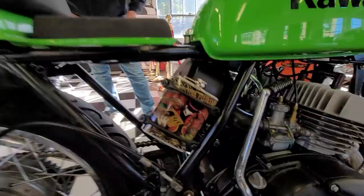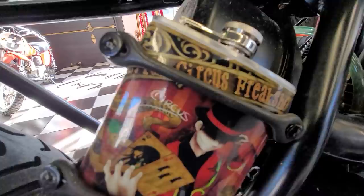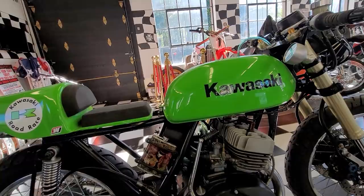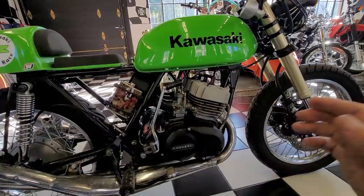Here's another piece — if you haven't guessed already, this is your two-stroke premix reservoir. It holds about eight ounces — so roughly eight ounces to two gallons if you want to run it a little bit retro. It's set up for premix, but it does have the oil pump back in there if you wanted to convert it back.